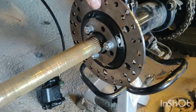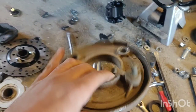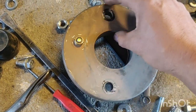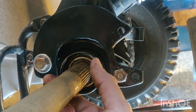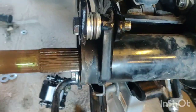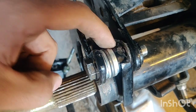For the mount, I got a quarter-inch plate. I copied the backing plate for the drum — the bottom hole and top hole — and made a cardboard template that follows it and goes around that bolt. Then I had to figure out my mounting for the caliper — how low or high I wanted it. I put the rotor on and tried to measure and get it centered. I also had to cut a little notch to give me more room for the bolts. I made it out of quarter-inch steel.